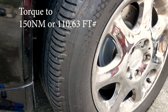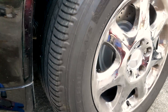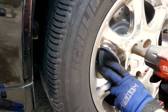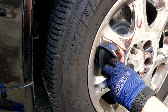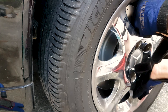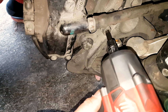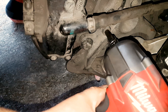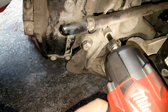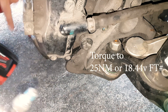Some of the tools you need — besides the normal stuff like a jack, jack stand, and wrenches — you need an allen key or allen socket, specifically the seven millimeter allen socket. That's the allen bolt that holds the speed sensor to the wheel.